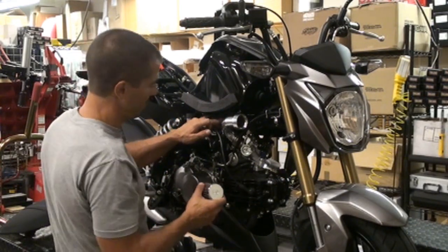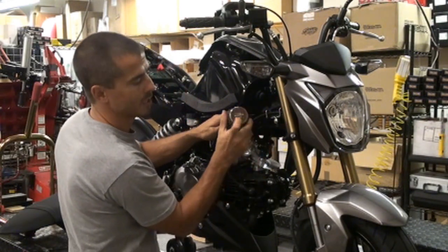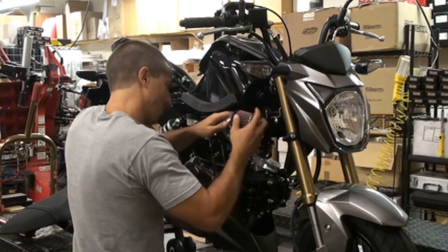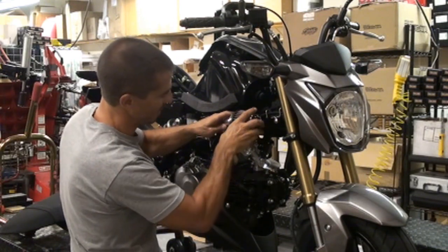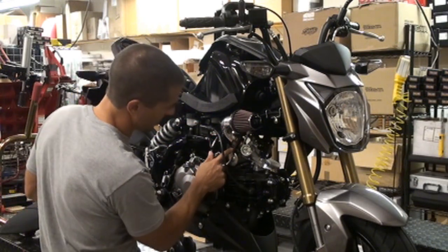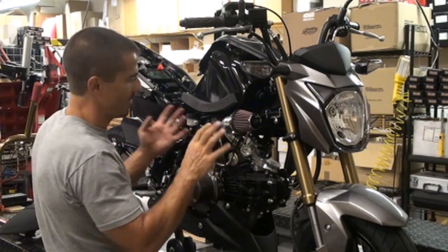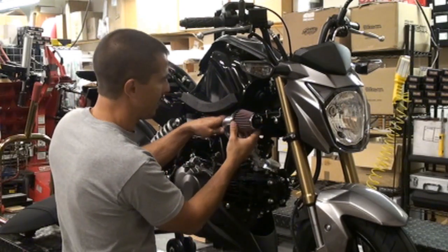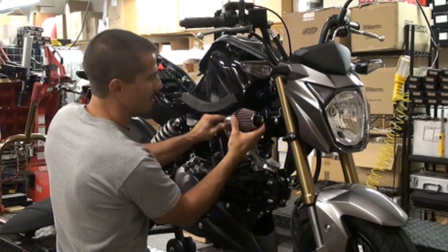Alright, so once you got your crank breather hose on, go ahead and put your filter on before you crank anything down. If you're anal, make sure your K&N logo is facing upwards. Slide that on there, all the way to the back of the flange. Make sure that your clamp is facing so you can access the bolt on it, and basically you want to make sure these clamps as well that you can access. You don't want them flipped around facing backwards and then you're trying to crank it all down and it doesn't work. So make sure it's got good clearance everywhere. You don't want it hitting anything. Remember, your body work's going to come here, so don't have it sticking way out like this. Make sure it's nice and tucked in there,